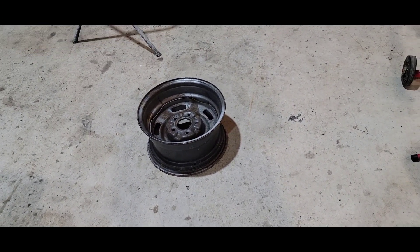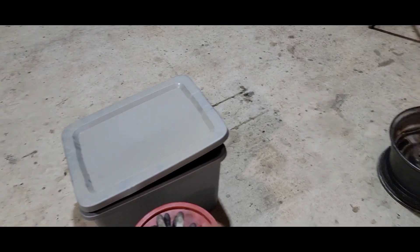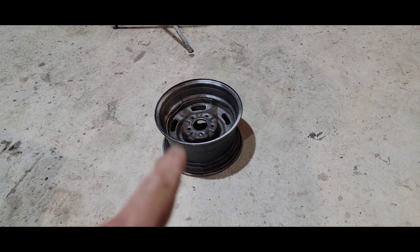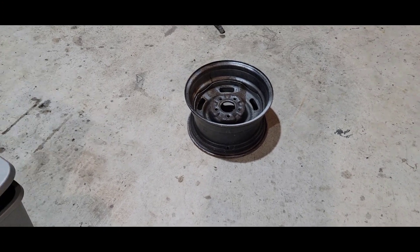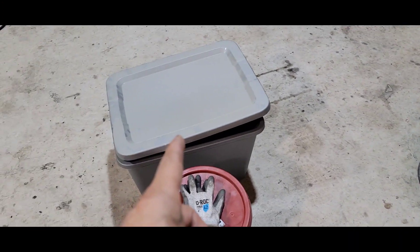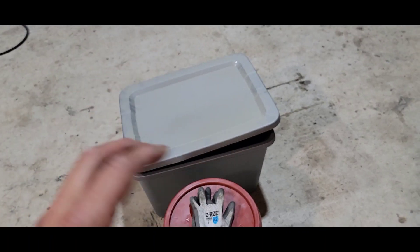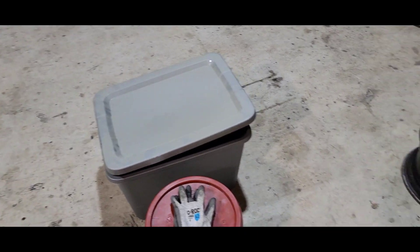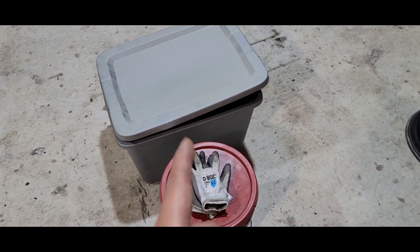That's what I got going on right now. I worked out here for about a good hour after I got out of work. Hit this one with the wire wheels and some sandblasting. Took this one out of the Evaporust from soaking. Rinsed it off real good with some water, so I'm going to leave that set overnight and hit it tomorrow once I get out of work. Get it cleaned up, and by tomorrow this one should be ready — totally de-rusted. Then I'll rinse it off real good, blow it off with air, get all the moisture out of it, and set it to the side. Get this one soaking probably one more time, and then dip another rim in there and get it ready.